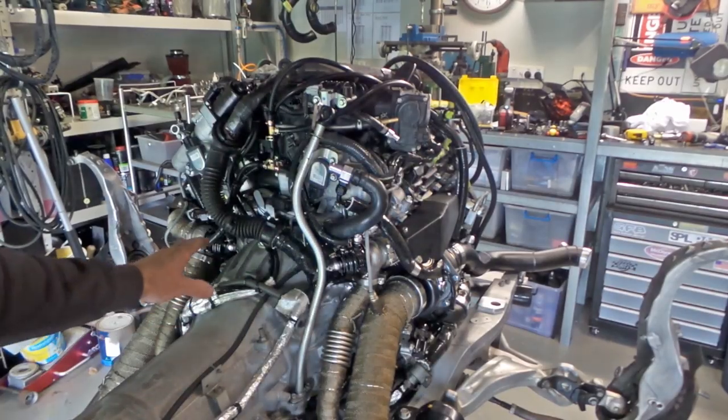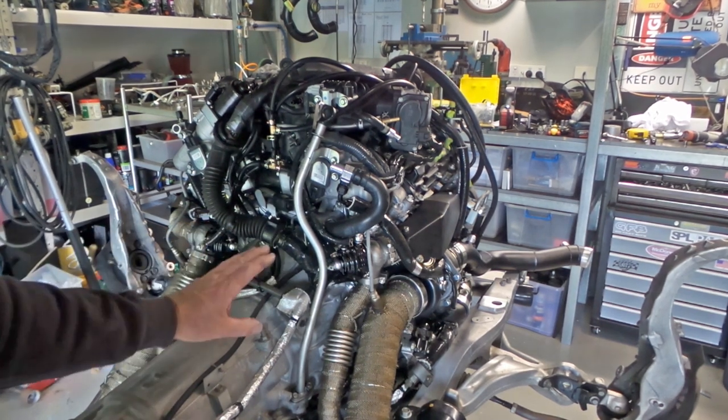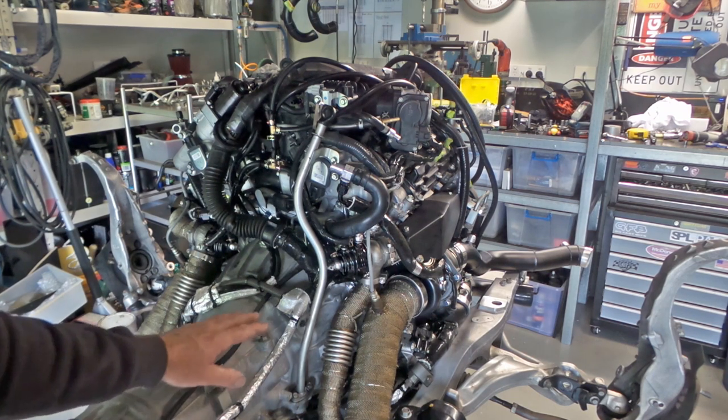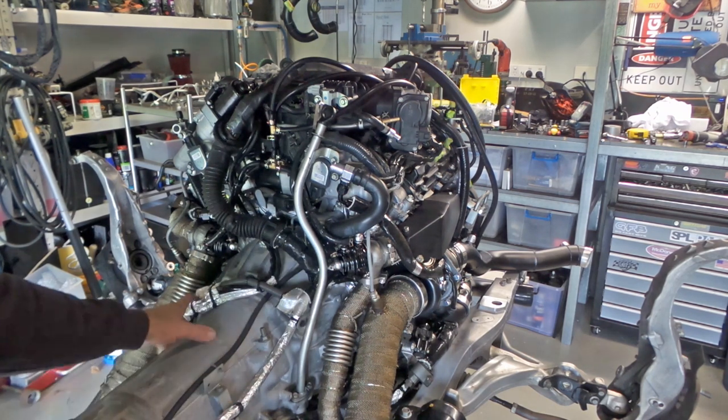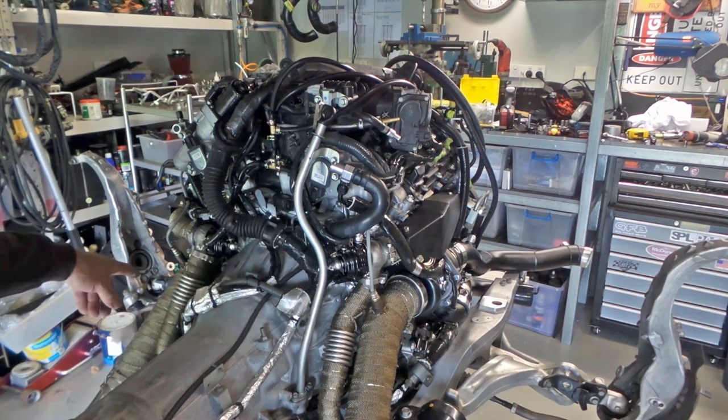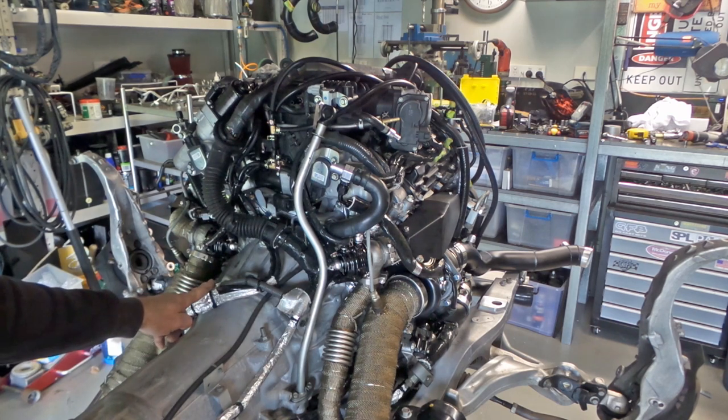So you'll notice here on the back, there is heat sleeving absolutely everywhere. All the control wires for the transmission have been re-sleeved. What sleeving was there has been extended. All the cables across this side, new cables, extra cables have been added in. I have an aftermarket oxygen sensor mounted in this left-hand side dump pipe that goes underneath and comes back up through this side.